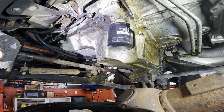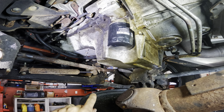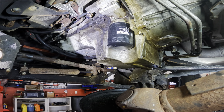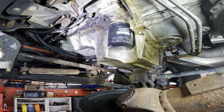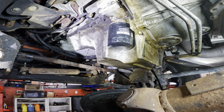Alright, looking good so far. Let's get this oil drain in position here, and we're going to drain this drain. I'll pull the filter off later - I don't want to do it right now because it'll just drain oil all over me. So we're going to drain this guy out, pop the perimeter pan bolts off and remove the unit. Then we can head over to the parts washer, clean it up, put it back after it gets a new gasket. And then our repair is complete.